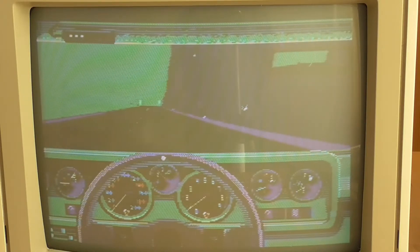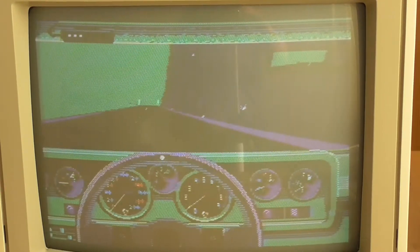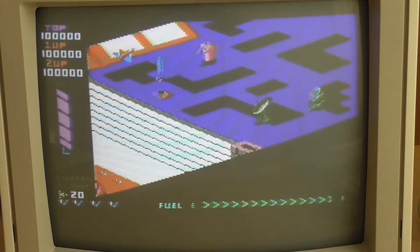This underlines the fact that you really need games written for composite mode. There were two types: ones that were 320 by 200 with four colors, and ones that were 640 by 200 with two colors. But in both cases the composite output will display 16 colors if the game was designed correctly — in the four-color case it takes two pixels at a time, and in the two-color case it takes four pixels at a time. So let's have a look at Zaxxon, or Super Zaxxon, which is a composite color version designed to work with the 640 by 200 mode.